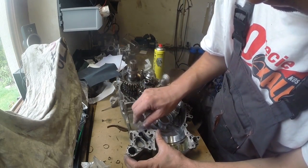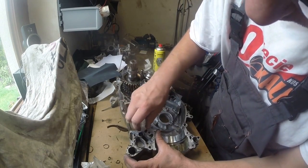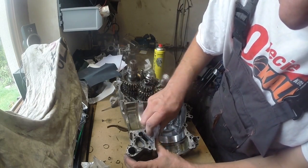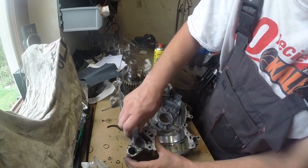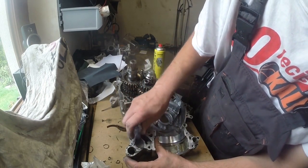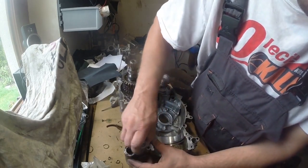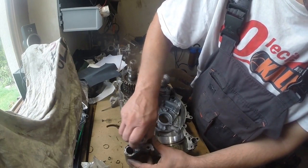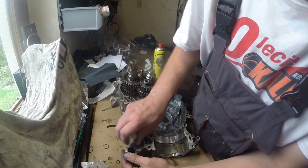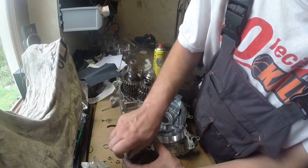If the surface is cleaned correctly and the O-ring is properly installed, there is no possible way to leak. Of course, there is always a way for failure, but generally it is hard to have a failure through this O-ring. People just did this because they were afraid that it might be a problem, but in my opinion it was not. A pure O-ring is enough in this place. You don't have to put a ton of sealant.